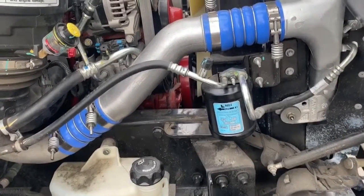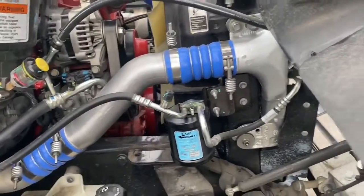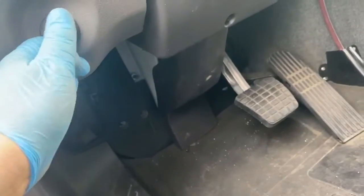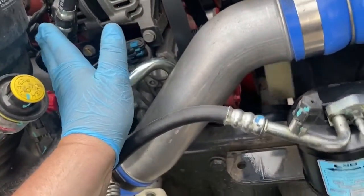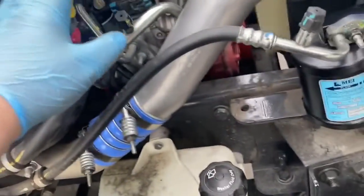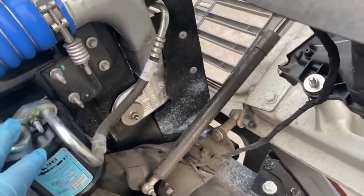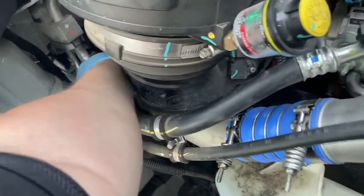We're going to show you the temperatures and the things you do when it's running. Just remember, be very careful — the fan's running and the belt's running, so be very cautious when you do this. Take all the safety precautions you can. Make sure you have chocks and all your safety precautions when you get ready to start this vehicle. You can see right now the clutch is engaged. So I put my hand here — it's hot. Put my hand here — it's still hot, but it's not as hot as this one. And then you come back and it goes through. First you've got to check and see the gauge, then you can check the temperatures by hand and see if everything's running right. And then it comes back out here — the fan's coming on. And right here, it's very cold to the touch. It's going right back to the compressor.